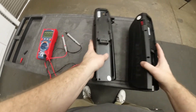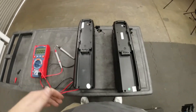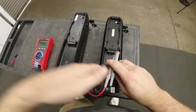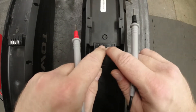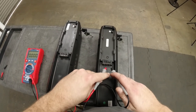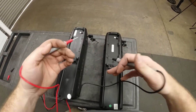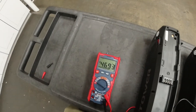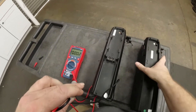I have two Tower batteries here, and both of them are switched to the on position, so they are delivering as much juice as the batteries can. I'm going to start with this one on the right. You're going to want to find the output terminals on your battery. Sometimes they'll be labeled positive or negative, and sometimes there's nothing there and you'll just have to place the probes on the spot. On our battery it's nice — you have positive and negative symbols, so it's easy. Red goes positive, black goes negative. If your battery doesn't have markings, you can still place the probes — if they're flip-flopped, it'll just give you the same voltage but negative, and that reading will still be accurate. We put the red on positive, the black on negative, and you can see it has shot up — it's giving out some nice, constant, solid voltage. This battery is fully functional and outputting voltage.